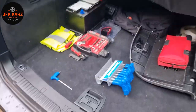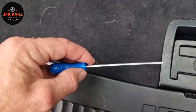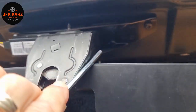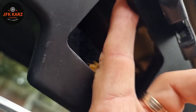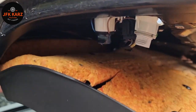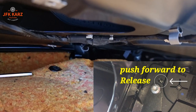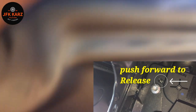Okay guys, here we are — I had to order some tools. I needed a little 3mm extension just so I could get to the little Allen key, which is like a release for the tailgate glass in here. I had to get this plastic off — it was super tight, I had to literally lever it off, and it just managed to slip round. Getting it back is equally difficult because you've got little flanges on the other side; you can feel them with your finger, but it does go. I was able to get my arm in from the passenger side — it's very difficult to see. I'll probably get a screenshot of the mechanism. You can see the silver bolt, and literally 12 o'clock up from that there's a hole — get in there with your 3mm Allen key and just push forward.